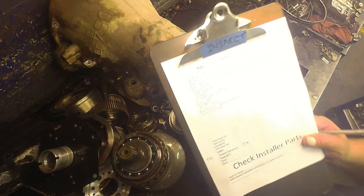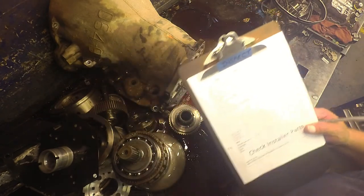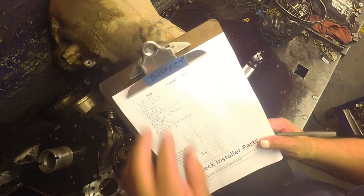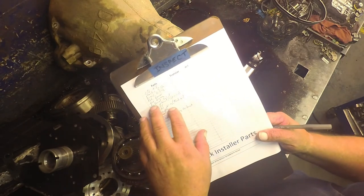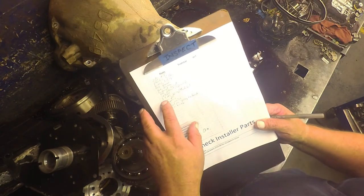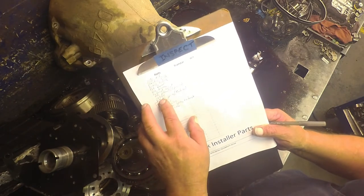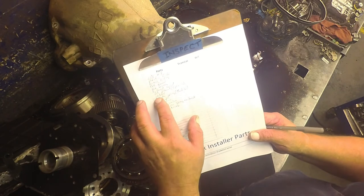All right, here we go. This is what we're gonna do on this one. We got an LS kit, a plastic filter, which is the deep filter, a pump bushing, a front band, a direct drum, a rear band, it's solid. There's two, actually, I think there's three different ones. There's a double wrap, there's a solid, there's one other. Let's see, where was I? Front planet, four pinion, there's different planetaries. There's steel ones, there's aluminum ones. It's three pinion, four pinion.